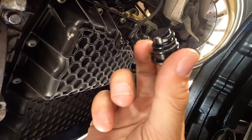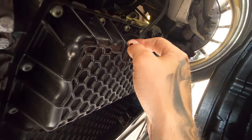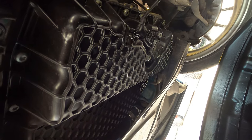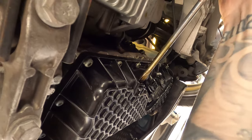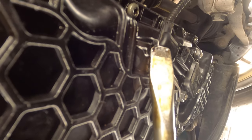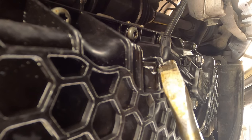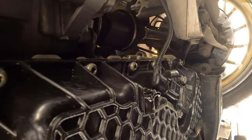Just put back the plug and we can start filling the oil. I've got the old plug here — make sure it's all clean. Put it in and turn it to the right a little by hand, then get your screwdriver and start turning it to the right. Under here on the plug there's a little part sticking out — that should hit the inside of the oil pan, so you keep turning until that tab on the plug hits the stop on the oil pan. Then it's stuck. Clean it off so you can check later if it's leaking.